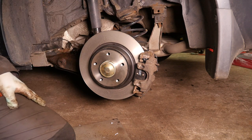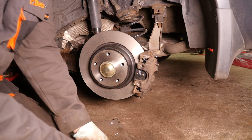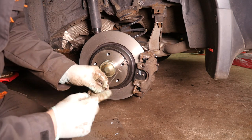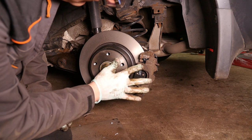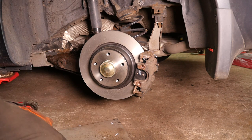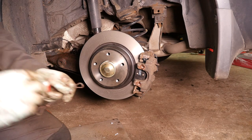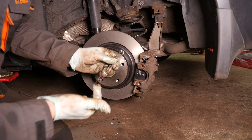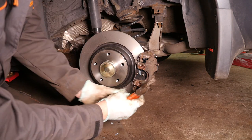And then we're on to the spring clip. Now for the spring clip, I will use a bit of copper grease. I think, bearing in mind how much trouble it causes if you can't get the pin back out, it might be worth just putting a little bit of copper grease on those two pins. And just try and push a little bit into the holes. I use Ceratec back on the other two contact points though. Hopefully they won't seize in again too quick.